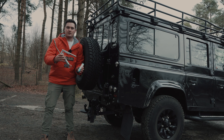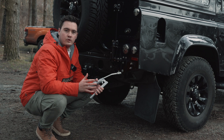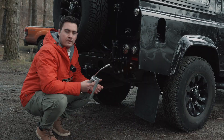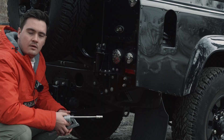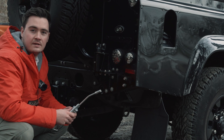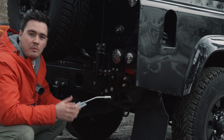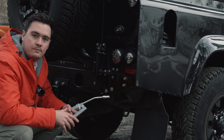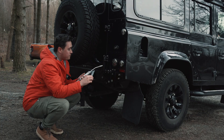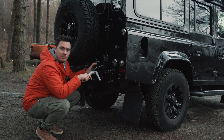If, like me, you've owned your carrier for a while and you've already topped it up with grease, you shouldn't need the full 80 grams as you did when you first bought the carrier — just pump a small amount into the void until you feel resistance, or if you see any grease popping out on either side of the seals. If you do happen to pop a seal, you've probably pumped a little too hard, but you can get a flat-head screwdriver into the space and push the seals back carefully so you don't damage any of the powder coating or the seal. Pump slowly over stages to ensure you don't overload the chamber and give the grease enough time to move throughout the bearings.